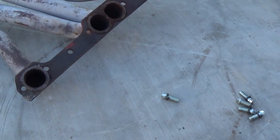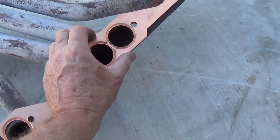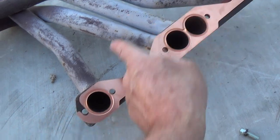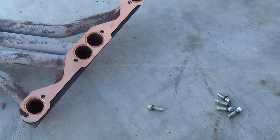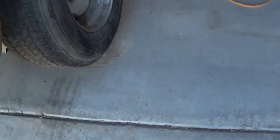Getting back to my van issue — like I said, these headers are specific for this Chevrolet G-van. As you can see, these gaskets fit perfectly on these headers. Another nice thing about these headers is they have this notch right here, so you put the front bolt in and the back bolt, and then you can just slip this gasket right between the head and the header — makes it so much easier. In case you're wondering, if you buy a set of round tube headers and you have a van or another vehicle with square port heads, you may wonder whether they'll work with round port headers.